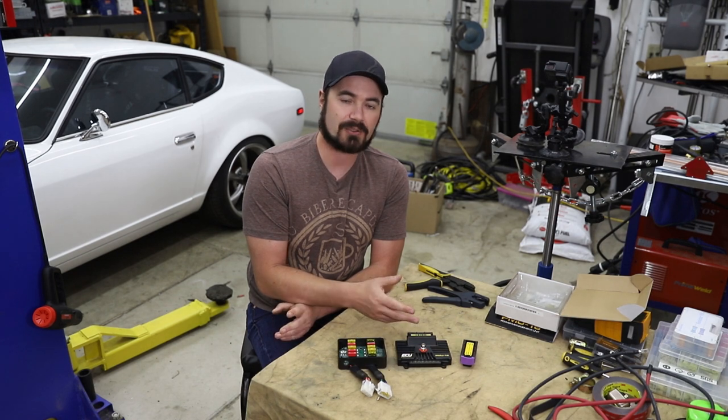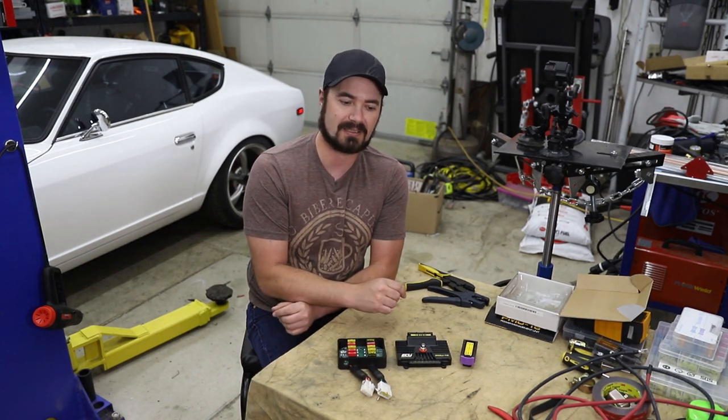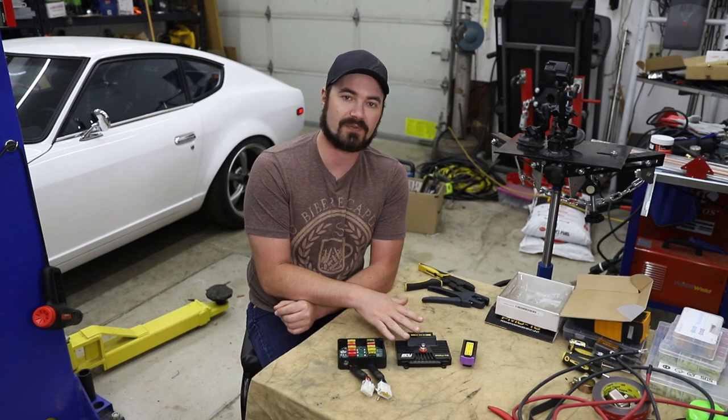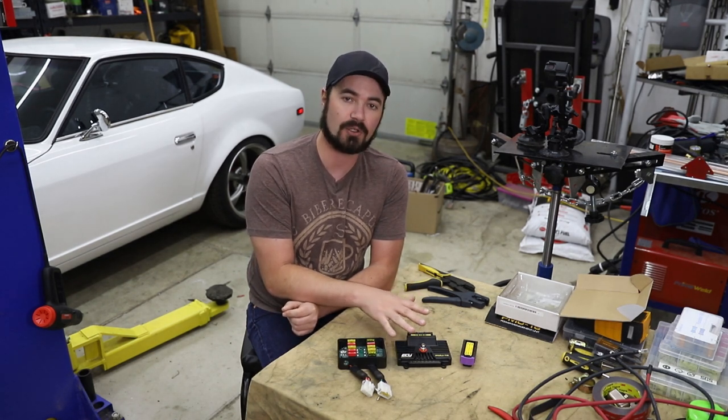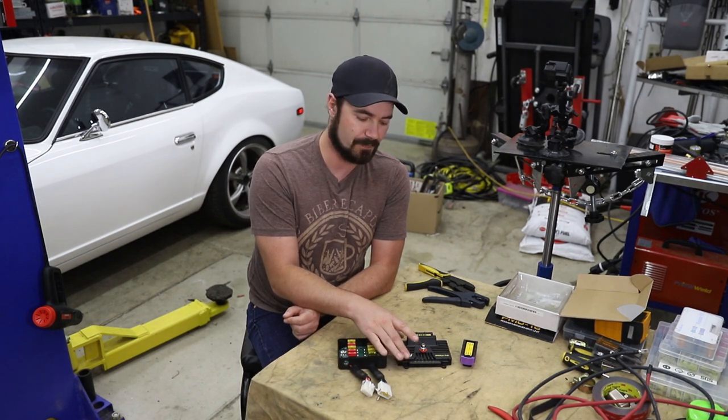To that end, I've reached out to Chris from BS for Build because he has a lot more CAD experience than I do, and he's going to review it and make sure it makes sense and see if it could be 3D printed first or if it needs to go straight to CNC. Ultimately, the final version of the plate and bracket needs to be in aluminum because it will also double duty as a heat sink for the PMU.